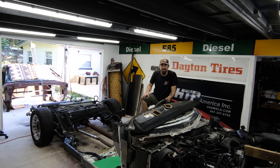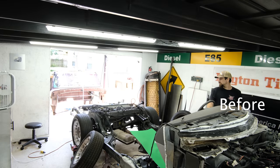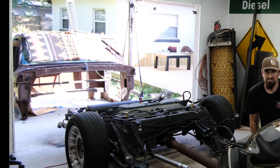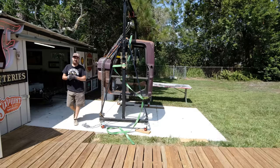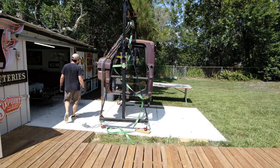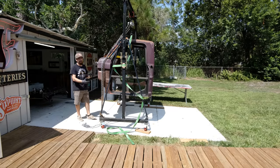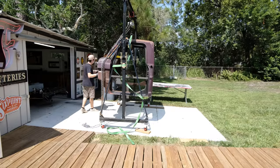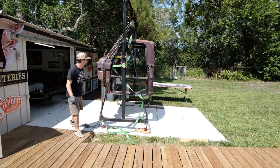I'm going to let it warm up a little bit then give you a few revs. Pretty good — I think I'm happy with that for the old shop truck. It is actually the next day now. I've been working on the cab but it is about 98 degrees and just too hot. I went ahead and primed everything underneath, put cavity wax in all areas with fresh metal on the inside. This had all been pressure washed — it's never a bad idea to pressure wash it, treat the rust, and then come behind it with cavity wax and seam sealer. All prepped. I want to back out the platform — now that the muffler is cut off it's going to be cool to hear it move for the first time.